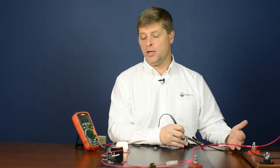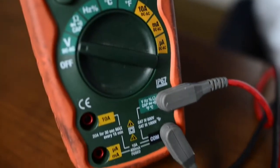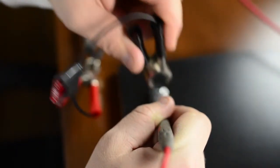This doesn't seem like a very important test, but this is something technicians will run across all the time — that truck that every Monday has dead batteries. By doing this test we can very easily see that, say, a truck has a little over half an amp of load. What is that load? We can now go through and isolate it, find out exactly what the load is, and fix the truck.